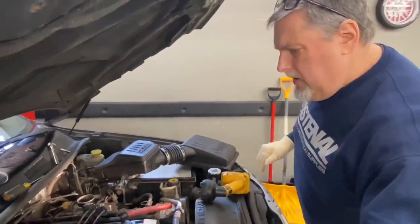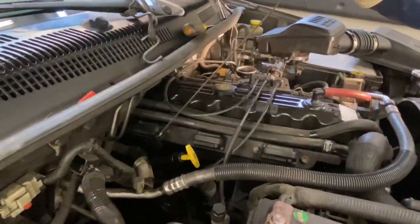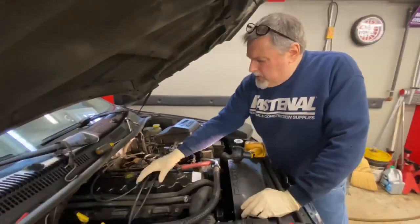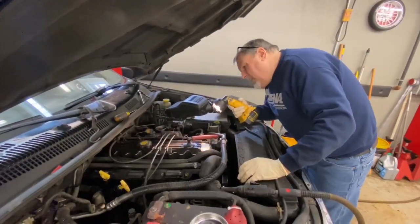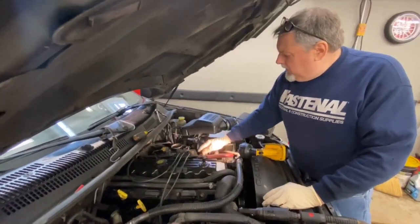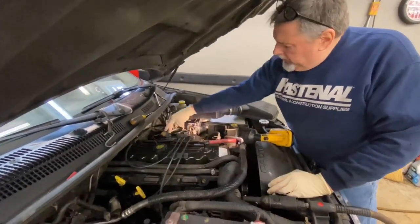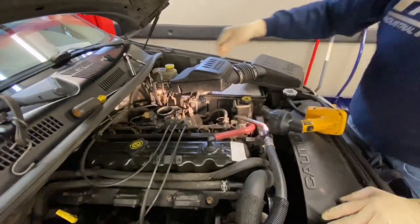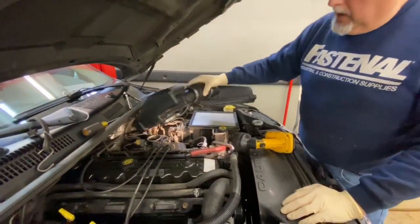All right, so on this side, we have the dipstick to put back in. And get that in. And we've got our brackets back on, tight. That one's tight. We have our bolts tightened down over here for the bracket here, for the linkage, accelerator pedal, and the transmission shift cable. We put a little thin coat of grease on this boot here so that our air cleaner just slides down nice and easy. And we got a 5/16 bolt from the back side here that we're going to tighten up over here and lock the air cleaner back down.